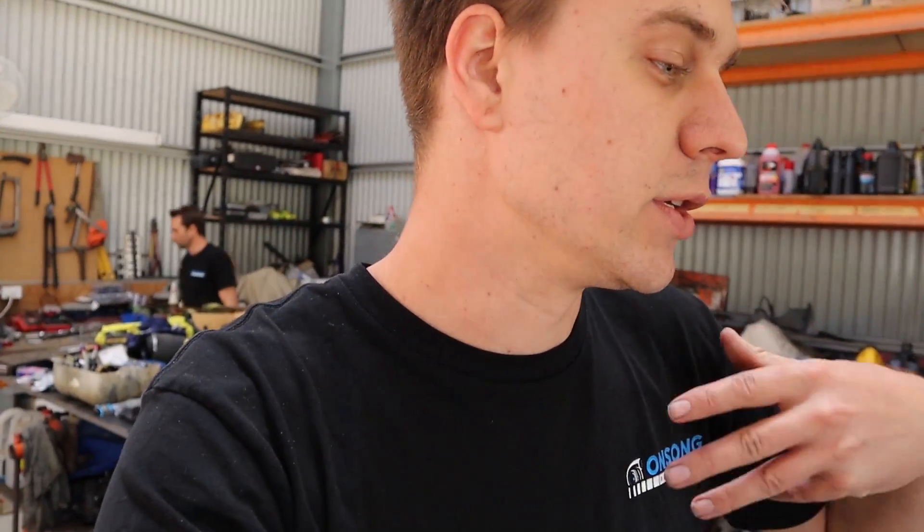Intake air temp is quite an important one, specifically on a car like this where we've got quite a small turbo that we want to push pretty hard and it's on E85. With E85, you generally don't run into your knock limit with your rear housing size, so you can push these turbos pretty hard. But due to E85 having a pretty low flash point, you really have to keep an eye on those intake air temperatures when pushing a turbo like that hard. Fuel pressure is obviously great for tuning in protection parameters for fuel pressure drop issues — that can save a lot when it comes to your engine investment. And oil temperature and oil pressure go without saying as two very good inputs to have to the ECU for protection parameters.